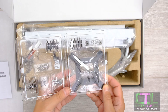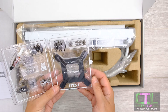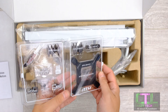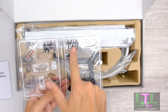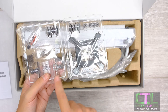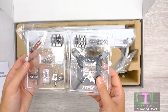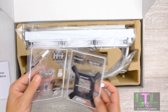If we pop this open we can see everything is labeled, so we know exactly what bits we need for our particular setup. We're going to be building an AMD system today, but we've got all the components listed out for Intel as well. I really like how this set makes it easy for a beginner to follow and install their liquid cooler. We've got the Intel bracket mentioned here, and we'll be using the stock AMD backplate on our Socket AM5 system, with AMD standoffs, Intel standoffs, and thumb screws.